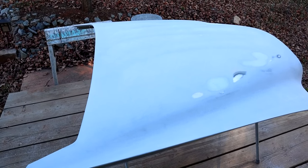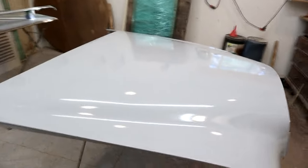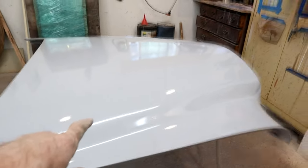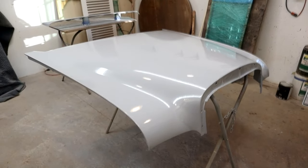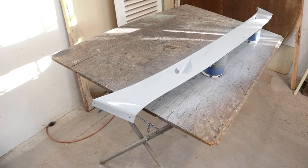That's it all reprimed up again. I put another couple of coats of VP2050 - you can see it's a little orange-peely; that's the nature of this primer, but it cuts down really nicely. The areas that we hit came out really nice and should block out nicely now. All I need to do is block this out up to 500 grit for a first coat of top coat. I've also 180-ed this cowling - just cut it down, degreased it, used 180 on that, and put a couple of coats of primer on that.